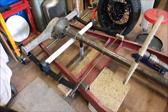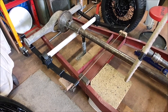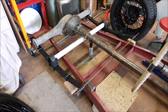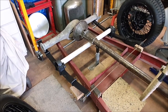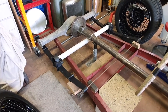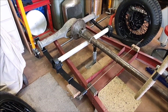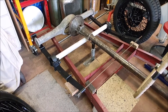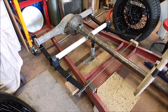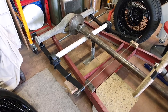I thought I'd take a break from the engine and try to get the rear springs in place. I went ahead and loctited the pins in place, hammered them home, and temporarily set everything up — and then realized there was something I really should have done before all that, which was actually measure that the rear tube was the right length. I kind of assumed it would be, and you can probably guess where this is going.